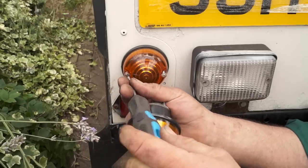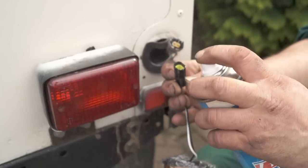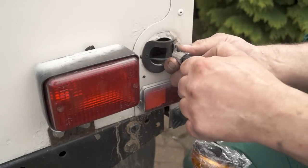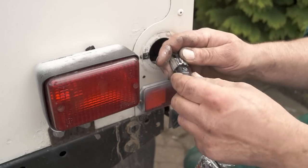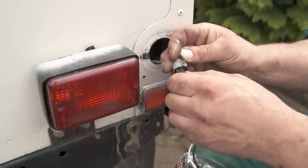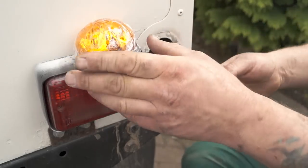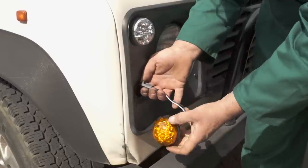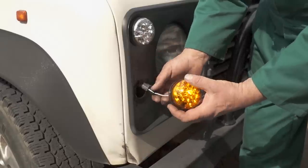So what we're doing is whipping out the old indicators — held on by screws, you know that anyway, you've changed light bulbs. I'm using a little bit of battery terminal grease to make sure that water is not going to get in there too quickly and to make a good contact. These are direct push fits. If the indicator flashes, that's fine. If they don't flash, then the polarity is wrong and you need to change the wires in the lamp. Now you can see the flashing rate here is right.